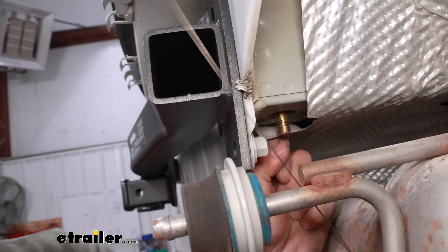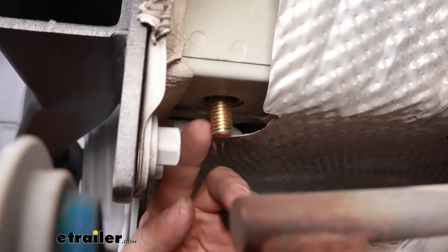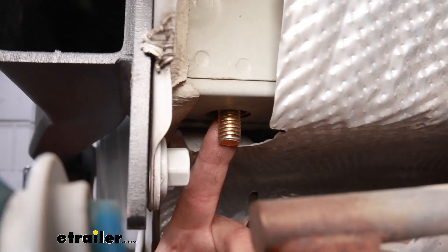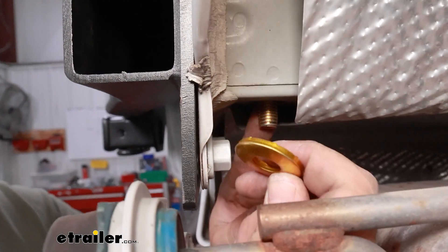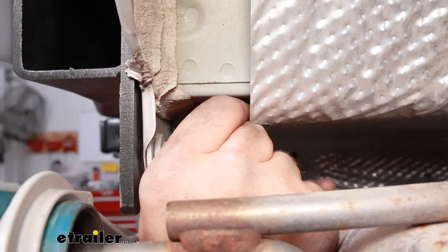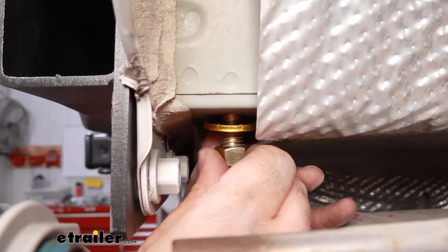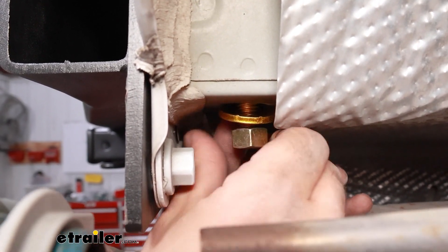It's very important that you don't push the carriage bolt back up into the frame rail. Put pressure on it when you place your washer. We have conical tooth washers that slide on first with the teeth facing up — slide that on and push on the side of the stud to hold it in place, then take the nut included in the hardware and get it started. Repeat that same step for the remaining three.